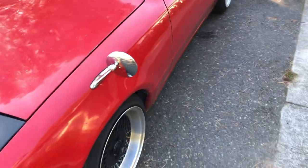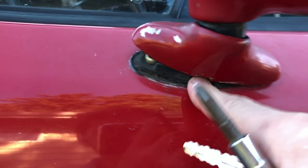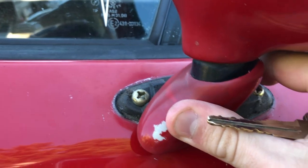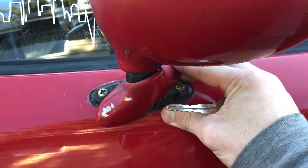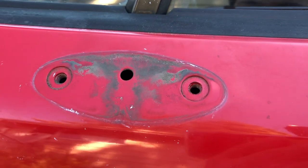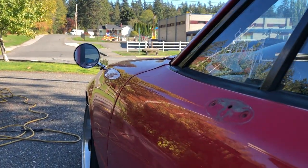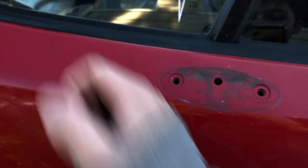They look pretty good. I'm pretty happy with them. I really like the angle that they're at — they actually help with the car being really low. I didn't have much visibility to begin with, so this hasn't really made that big of a difference. To take the stock mirrors off, this piece always gets stuck on here because it's all OEM. I just took a key under this little piece and popped it right off, then basically just unscrewed the two screws and it comes right out. The driver's side mirror is off — oh my god is there so much dirt here. There are three indentations we'll have to fill in with Bondo, but there's a lot of dirt. I'll try and clean that off best I can with a microfiber and some water, then we'll polish it when we polish the entire car.